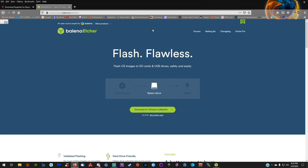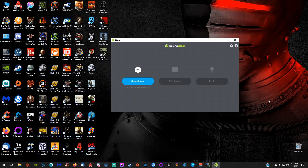A quick side note: if you have an SD card that is over 32 gigabytes, it needs to be formatted into FAT32. Unfortunately, you can't format an SD card or USB drive into FAT32 if it's over 32 gigabytes in the Windows 10 environment. There's another program you'll need to use for that — I've got a video on how to do it, I'll put a card up so you can click on that. For those of you with 32 gigabyte cards and smaller, you're just fine, don't worry about it.